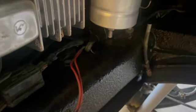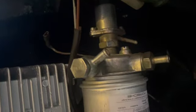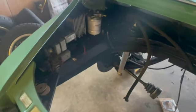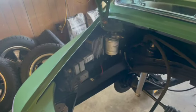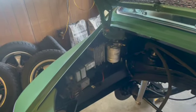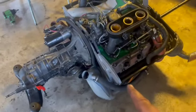The pump has two barbs on it. Now we still have three barbs up top here. I don't know if you guys can see up here, we've got the cold start injector, the spray and pray, which is 5 millimeter. All this other stuff is 7 millimeter. So we're going to start running our fuel lines. That's next. We're not going to use that factory Porsche pump. We're probably going to use, I forgot the name of the pump, it starts with a P. Apologize about that. This little guy here had to do it twice.